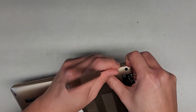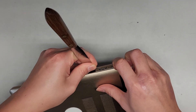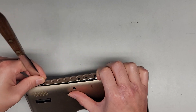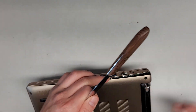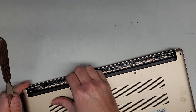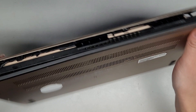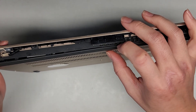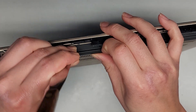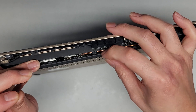I'm going to try and get my fingernail in there. You can use plastic pry tools, whatever works for you. Then I'm going to slide this tool in while I'm kind of pushing the clips inwards — and there you go, it's popping out. Then the back, if you can, I would recommend popping this side up as well. But since this is missing that back piece, I can actually get in here with this tool to help pop it. You can see there's a clip right there.